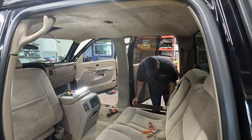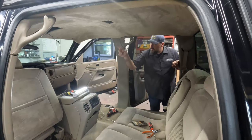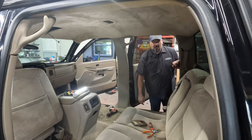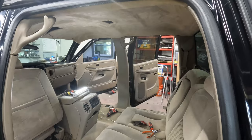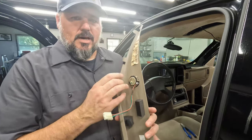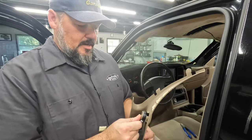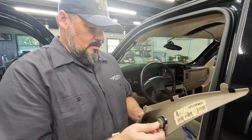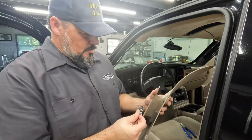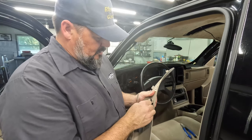Put these trim pieces back on. We've got to go to the front — get the front pillars and that console piece put back on, then we've got the seats back in. It's almost a whole truck again. All sorts of audio problems today. Speaking of audio — if you recall when I took this out in the very first video, the speaker popped loose. It was glued in, but it doesn't have to be. It's got little tabs on it — it does clip in, but it kind of seems like some of the clips are broken out, so I'll probably put a quick dollop of silicone on there.